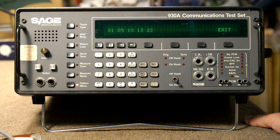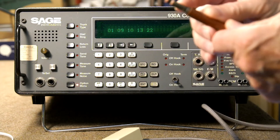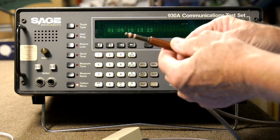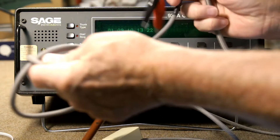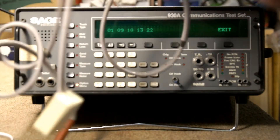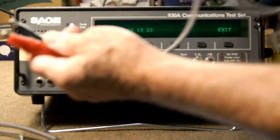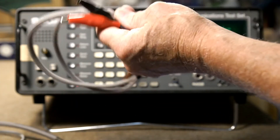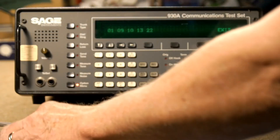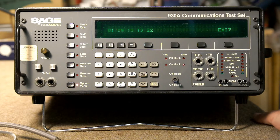The other thing that you will need to test old telephones is a cable with a Western Electric 310 connector on the end. It looks like a stereo phone plug, but it's not. I just found one cable on eBay for about $10, and I cut it in half. On one end I installed a standard modular phone jack, and on the other end I installed just two clips, so I can hook those to the red or green wires of a phone that doesn't have a connector on the end, or if it has the old standard 4-pin plug used before the modular ones came out. Basically, with a couple of adapter cables and Options 1 and 13, you're good to go.